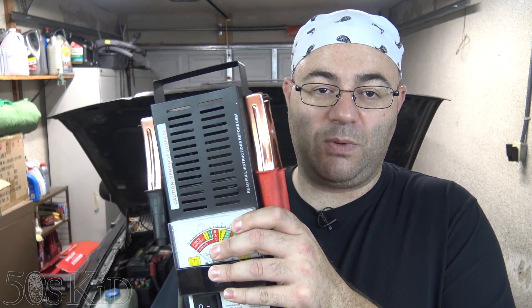You don't know how many starts your battery has left in it. You don't know where in your battery's life cycle it is — it could be down to 50% capacity from when it was brand new and you wouldn't be able to figure that out with one of these testers. You also wouldn't be able to tell what the level of charge is, because your battery could be down to like 20% and it might have one or two starts left in it. You'd only know if it could start your car one time.